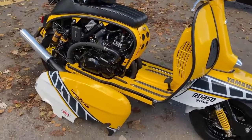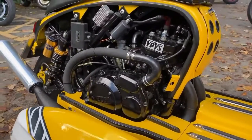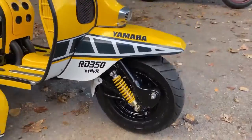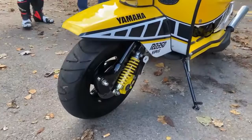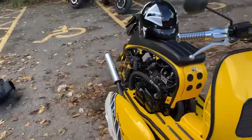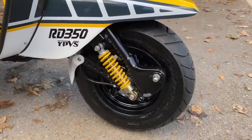I was out of work and did it in a year. That's impressive for the time frame and level of work. Even at a year you'd expect it to be a bit of a guinea pig build. On the front I took off the inner springs, put outer springs on, and the other side is an anti-dive unit I made myself. What's your background — have you been bike building all your life? I just used to follow my old man about in the garage.